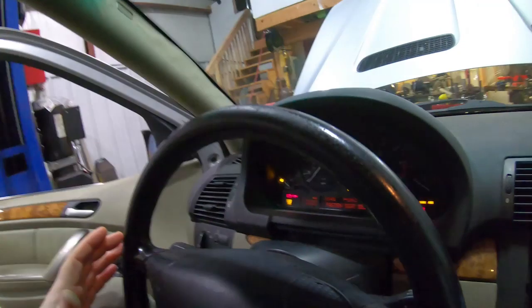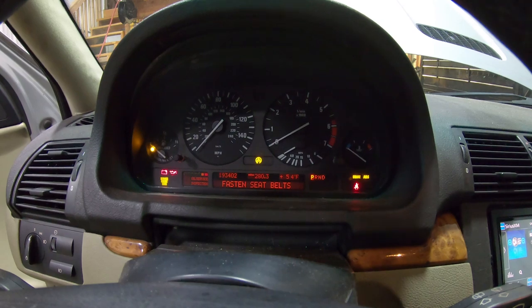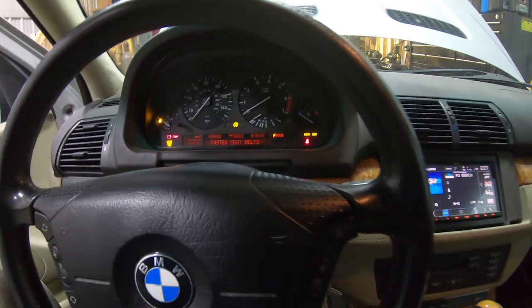What's going on everybody – Mike's Supra exhaust is done and everybody liked it. Now we're moving on to something else. We're sitting in my 2001 X5, which has been neglected for about six months. When we moved the shop we blew some airbags in the rear, fixed those, then had a wheel speed sensor go, and then a few other little odds-and-ends issues – like the front lower control arms need to be replaced because every time you hit the brakes it steers wherever it wants to go. It's a pretty common issue with these. So it's about time for a suspension refresh, and we're going to replace the lower control arms in this video.